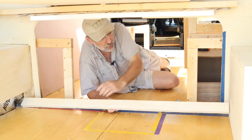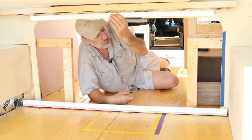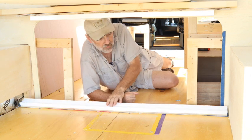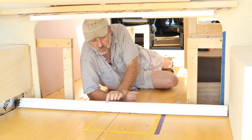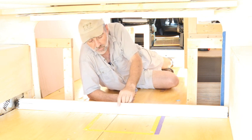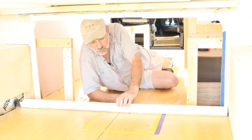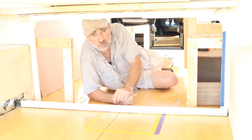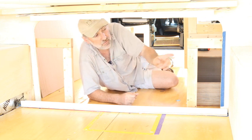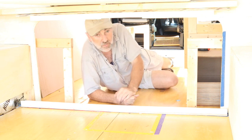To make it easy, I cut about a three-inch wide piece of plywood and attached the track to that. That lets me position it, move it around, get it in perfect alignment with the top track, and then screw it down. This lattice track works really well — it's thick enough to keep the panels far enough apart that they won't rattle into each other while driving. If there is any noise, I have room to put felt inside the track to quiet them down. I also expect to put magnets on them so they'll click into closed position — one to the left, one to the right, and one in the center — to help keep rattling to a minimum.